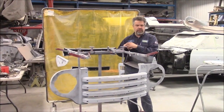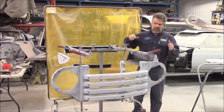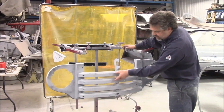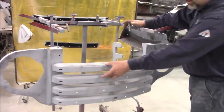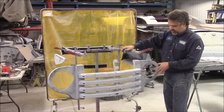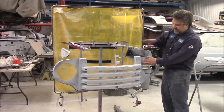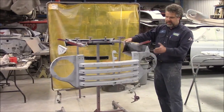These are the front nose components, and a lot of people aren't familiar with how many components there are when you disassemble the front of a 1950 pickup. We have our front grille, and this grille assembly is the upgraded model where these bars or bands are painted, and then you can see where these holes are and this groove — they have chrome strips that are attached. So that's an upgraded front grille assembly to have the chrome slats. This is basically a background with fairly large fenders with eyebrows that come out — an inset style to the front nose on the F-1 and F-47 Ford trucks.